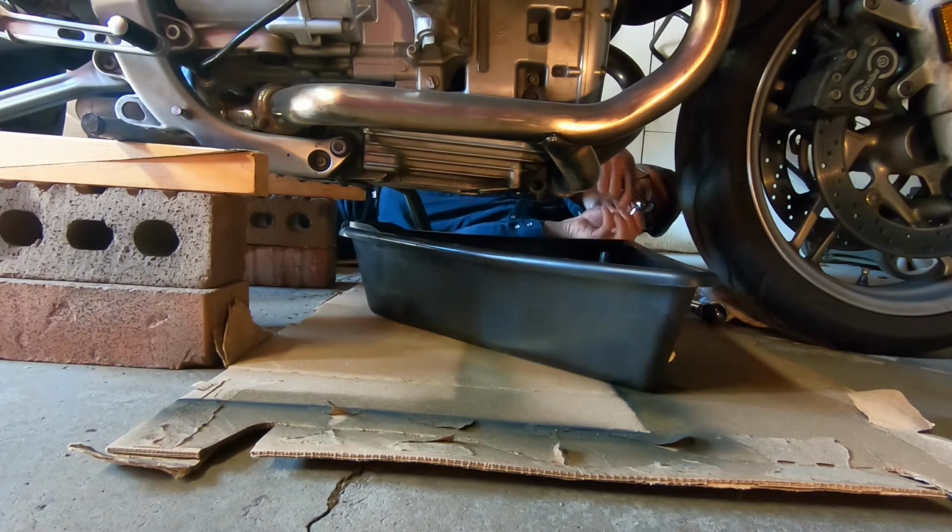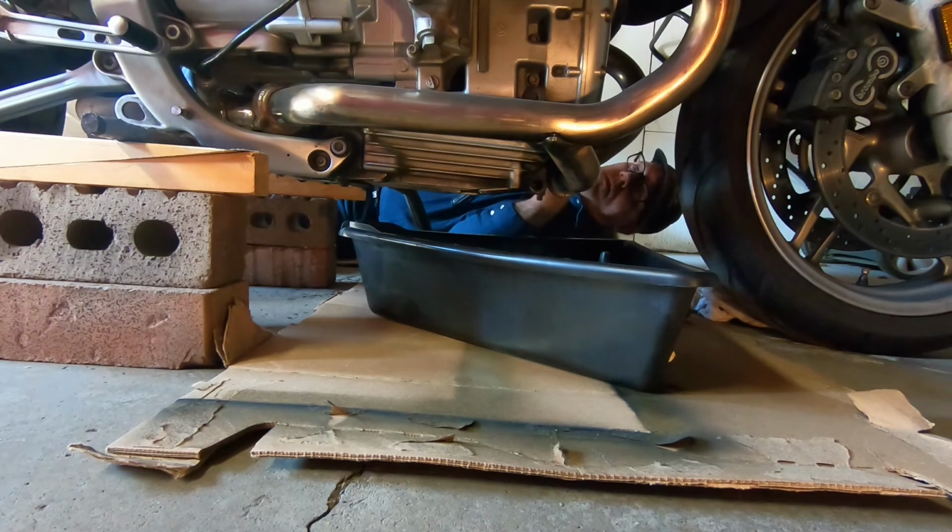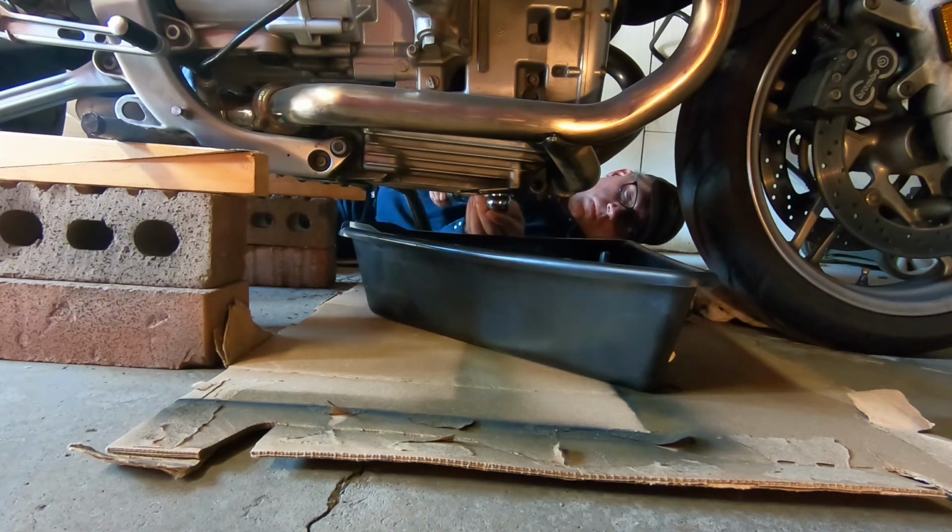So here I didn't do that, and I never actually researched it before, but depending on who you talk to, if you have an oil filter like that, most people recommend that you pre-fill it before putting it on your car or motorcycle. If it's a great big truck with a huge capacity, you definitely want to do it, but I've read from this forum and this website that it really doesn't matter too much on modern engines. They say it doesn't hurt to put that oil in there, and definitely get the oil around that rubber gasket so it doesn't stick when you take it off again.